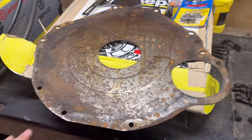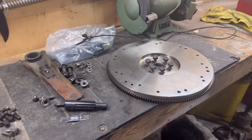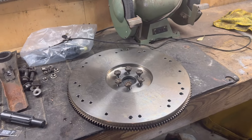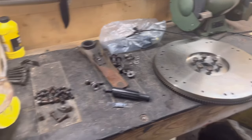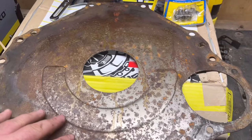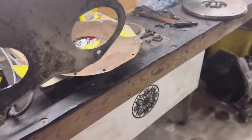This plate right here — the dust shield — has got to go on first. Make sure you install that first, because once the flywheel is in there you'd have to take it all back apart. I've even seen guys go all the way to mounting their transmission and realize they left the shield out. The automatic and manual shields are different, so don't reuse your automatic one.